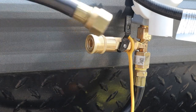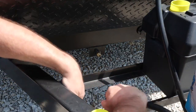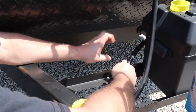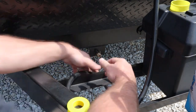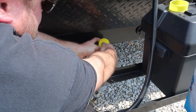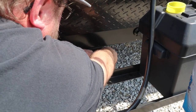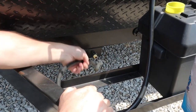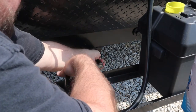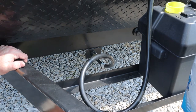The last step — we've got to connect this hose back to the main camper. Small spaces to work in. Feed that back through the zip tie. I'm going to put some gas tape on this here too. Now we're going to put this back on the main camper line. We don't have to be too tight — just nice and snug. And that's all it took, about a quarter turn. We are good to go.